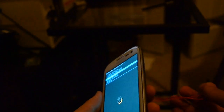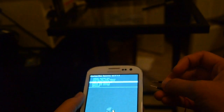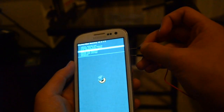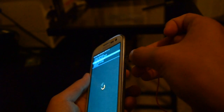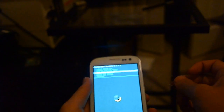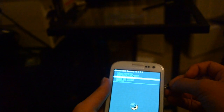In order to select an item on the recovery menu, you basically just take the two ends of the wire — you can get this wire at Radio Shack or on Amazon. Insert the wire into the hole. The key is to have the two wires on the two sides of the hole, because there are two metal pieces, one on each side. When you put the two wires across them, it basically means the power switch is being pressed — we're shorting the area where the power switch once was.